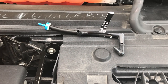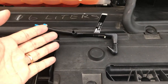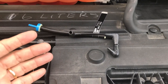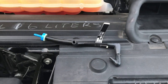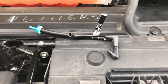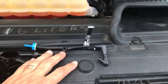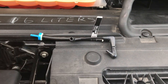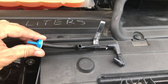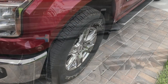One of the consequences of not replacing the valve and leaving the wheel potentially grinding is that it could end up being a much more expensive fix. This is an inexpensive fix — the valve is going to be between fifteen and twenty-one dollars with shipping. If you damage your front hubs from the IWE, that's a six to seven hundred dollar repair. So it's certainly much better to just replace the valve. I also found out this is actually a maintenance item — probably every five or six years this valve is going to go bad anyway, so it's something you want to replace on a four-by-four F-150.